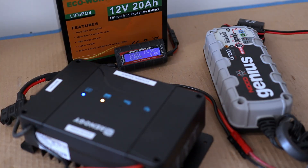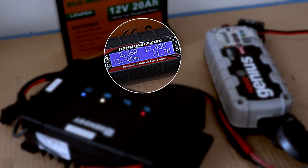There are a couple more advantages of having this set up this way. This allows me to hook up a battery charger, whether it's a trickle charger or something else, that can provide a consistent voltage of more than 13.8 volts to allow lithium battery charging through the device. Another option is in a vehicle while you're traveling — I can take my Anderson PowerPole connectors and connect them in-line with my alternator in the car or truck to give me that 13.8 volts, and this will take that DC to DC charging to charge up your battery.